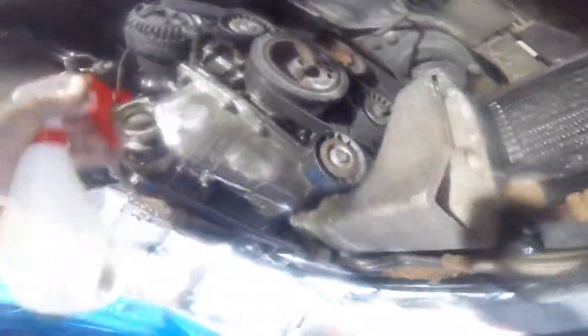But what I do with the alternator instead is I just dip the scrubbing brush in the pool with all the spent fluid and diluted water. Diluted product with the water. And I just use that brush to scrub the casing of the alternator. And then I don't actually rinse it down. I just wipe it down with a rag. So just giving around that diff a good scrub on this side before rinsing it all off.